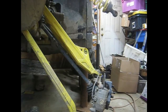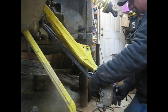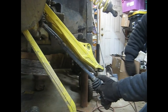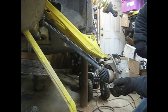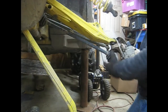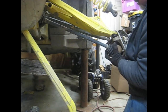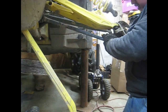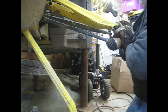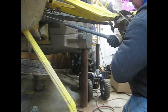I'm going to show snatching this axle out — sometimes this works good, sometimes it doesn't. I've got the bottom control arm off and the nut off the end, so we just need the axle to slide through the knuckle. Tapping it with a hammer — it's a little stuck. Just pick the A-arm up a good ways to get the axle to slide out.